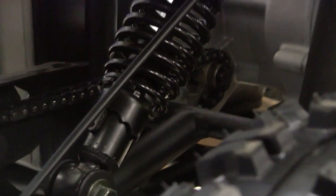This is the engine sprocket, and too tight of a chain will wear out your engine sprocket and will also wear out your chain, not so much your back sprocket. So what we do is adjust the chain.